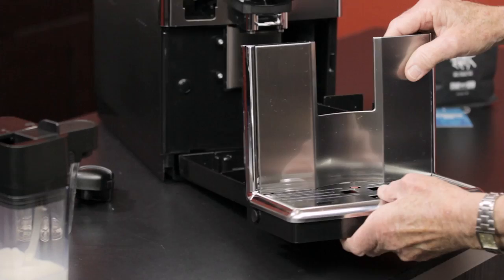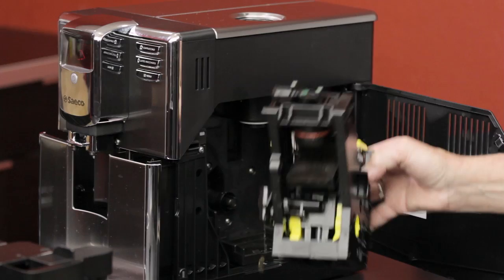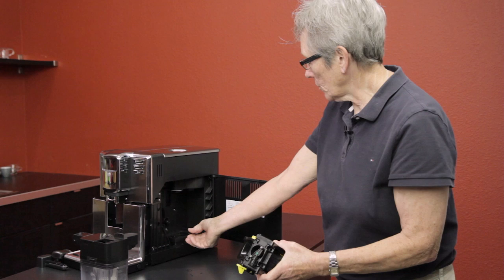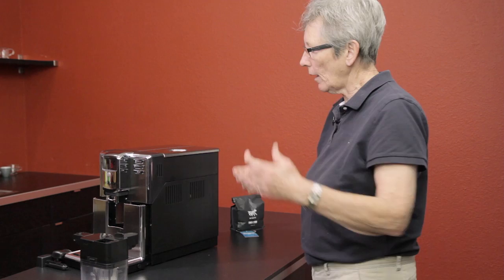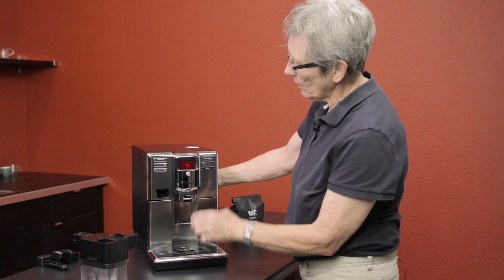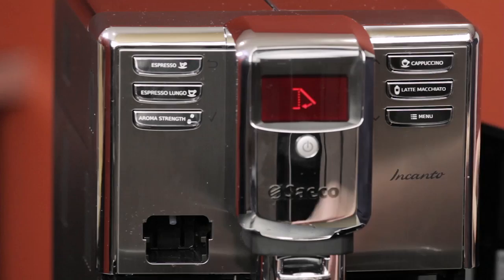On the side here is the brew unit. You want to take this out once a week and rinse it with hot water. If you don't, the little screen down inside gets clogged up — the screen on the bottom of the plunger gets clogged and nothing will come out. There's also a little tray down inside — take that out and clean it as well. Super automatics take a little more care and feeding, but hey, you push a button and have a coffee every day. There's also an error message — a picture of the brew unit — that tells you if it's not seated properly. Once it clicks in, you're back to the home screen.